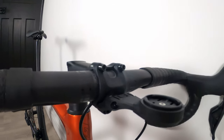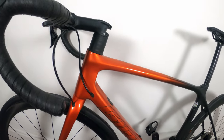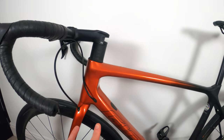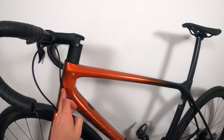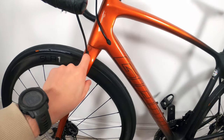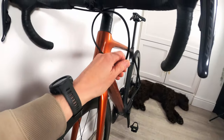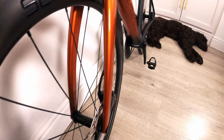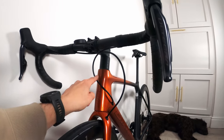I've just swapped the bike around so you can see the cable routing. Since the shifters are wireless, there's no Di2 cable — there are only two cables for the brakes. The rear brake goes through down the side to the back, and the front runs through the front fork as normal. I would say the front brake cable is a little too long and probably needs chopping back from the caliper by about two to three inches to get rid of the big loop and tidy it up.